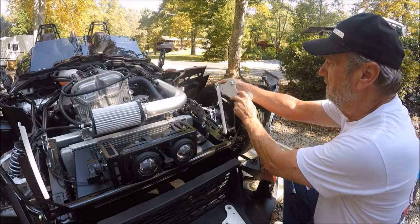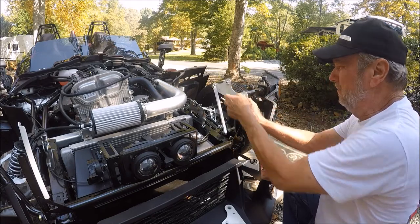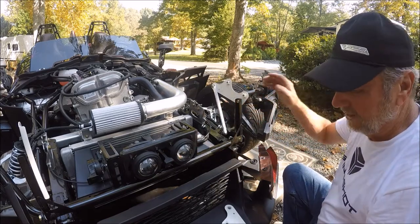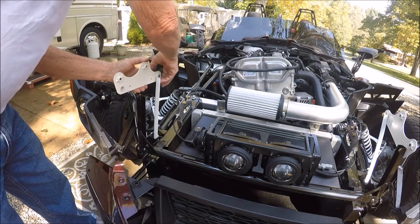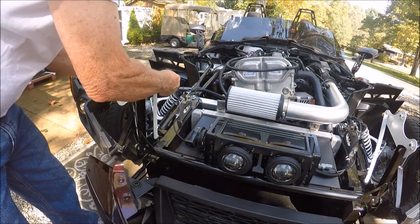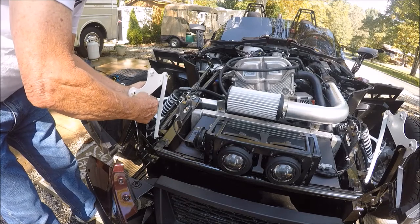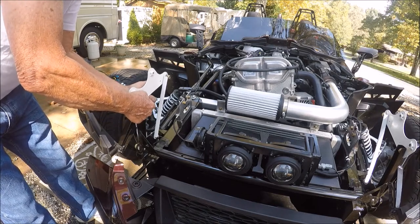Take the correct pivot plate and put it into its front arm position, then put that nut in place. Use your quarter-inch Allen and 14 millimeter socket and open-end wrench to tighten. Do this for both sides — start at the back, go to the correct side, and that goes on the inside. Hook in there, give it a few turns, then use your tools to tighten this up firmly so the latches move freely with a little resistance.